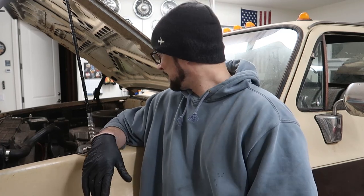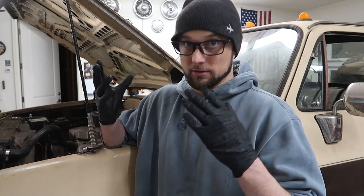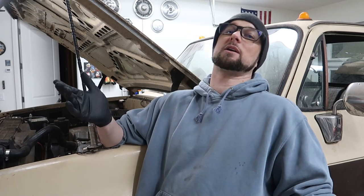I'm happy — I got that master in finally. It looks so pretty! But we're not done yet. We've got to bleed all four corners of the vehicle still to get the fluid through everything and get all the air bubbles out. I want to get that done tonight before I get lazy and end up not doing it this weekend. Then these brakes will be completely finished — besides the parking brake, since I don't have parking brake cables yet. But it'll stop on its own.